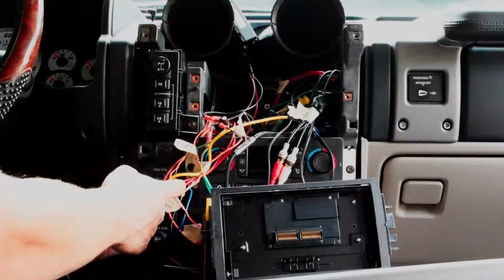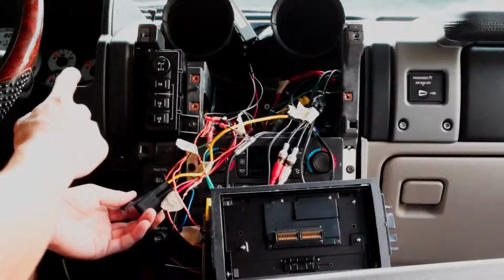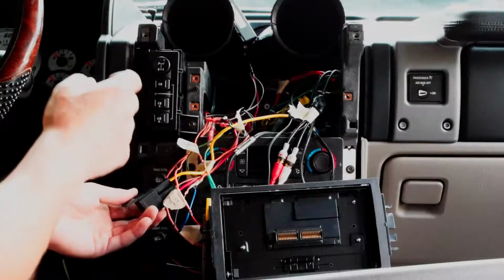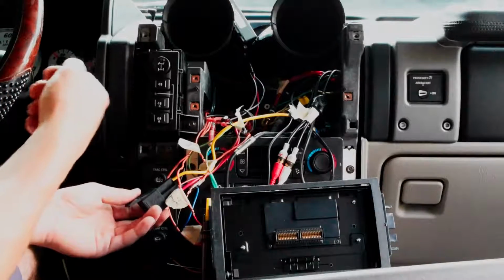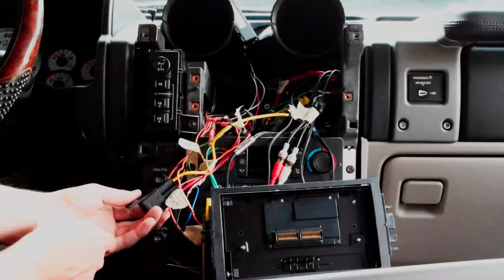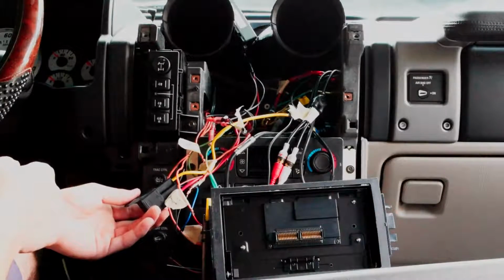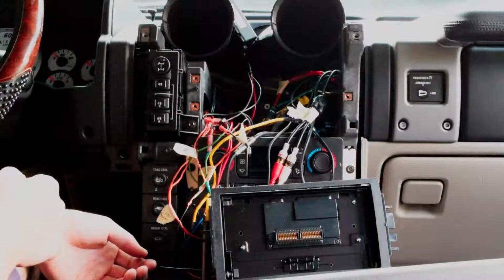So what happens is this relay is powered but it's not on, but when it senses a signal from a different lead on here, it'll actually turn it on and allow the high current to run through, and you can actually signal it with like a low voltage signal. So it's interesting. I guess they used it because they wanted to power things in the car with the remote turn on. So I use that as well. It powers the equalizer and also the DVD player in this car. So that's another cool thing.